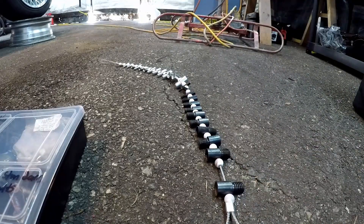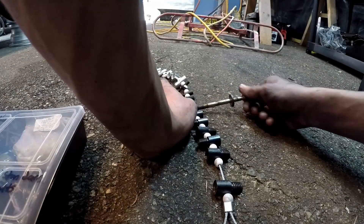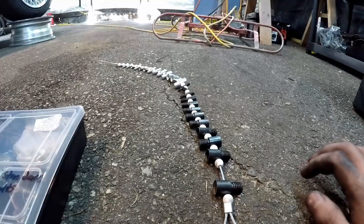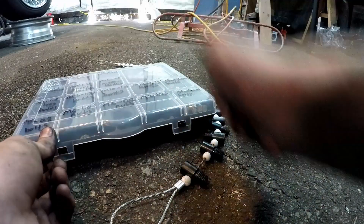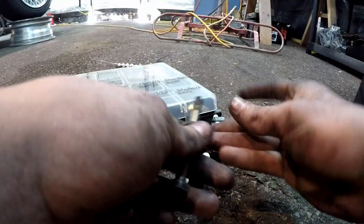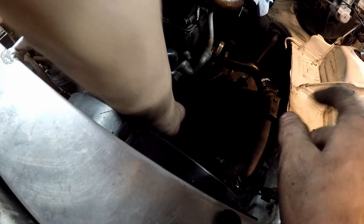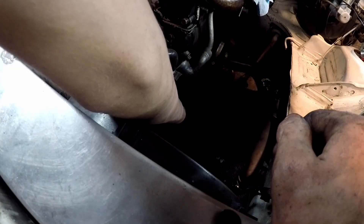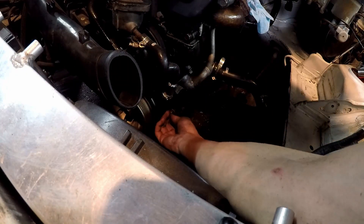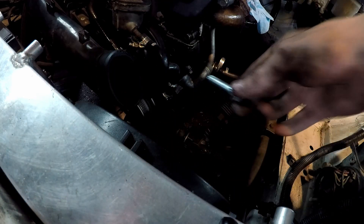This little thing is one of my favorite tools now — I simply just put the bolt straight in there and I can find what thread pitch it is. This one's an M8 by 1.25, which I think I have a lot of. I'm going to come over to our bolts, grab an M8 by 1.25, and see if that's long enough. That's not long enough. Let's try to find one longer. I did find one a hair bit longer, but that isn't long enough either. We're going to have to make a trip to the hardware store.